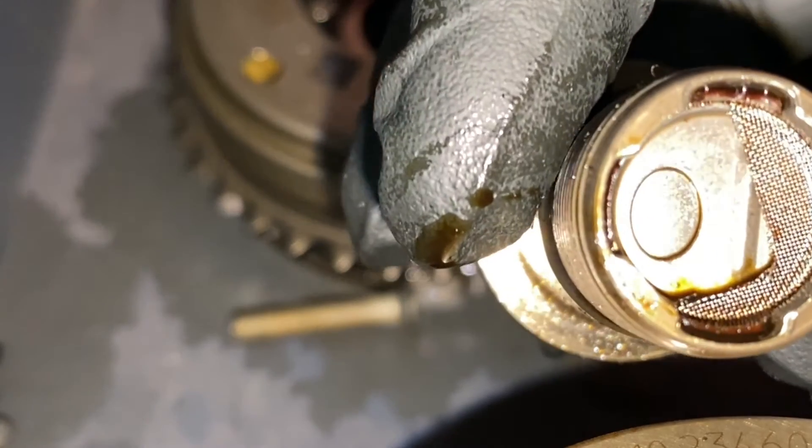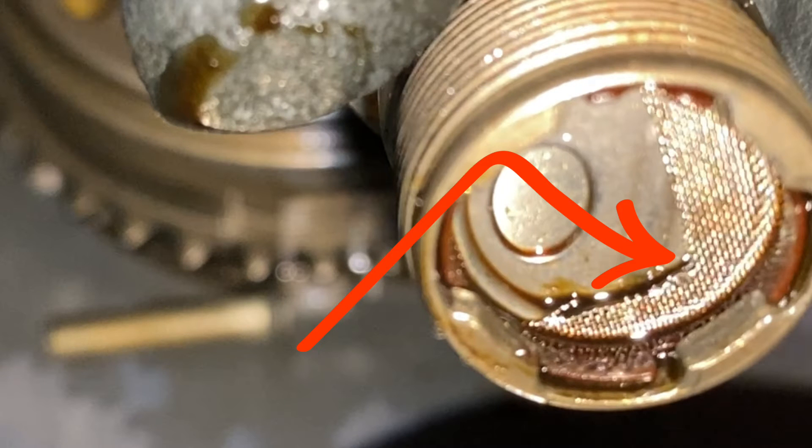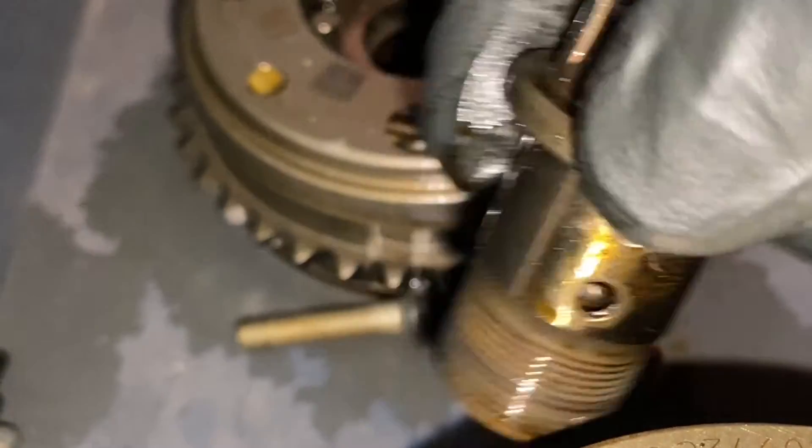And there's the exhaust one - as you can see, it's been torn out completely. I have no idea to this day how that happened, and BMW hasn't been able to tell me either. Once you lock your engine up with the timing kit and you see that, change the VANOS sprocket as well. There's a little flap in there that allows the oil to flow back and forth like a little poppet valve. All that debris goes straight inside and, as I found when I looked at the VANOS sprocket, it jammed up against the wingtips.